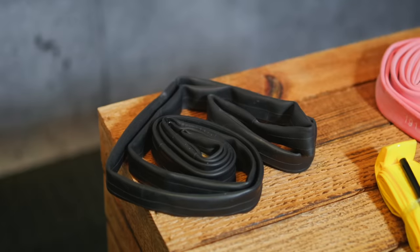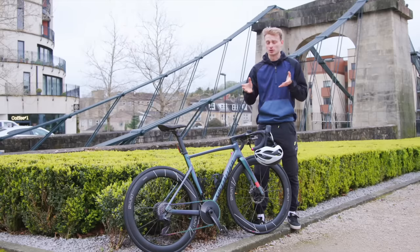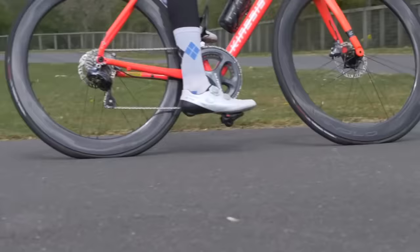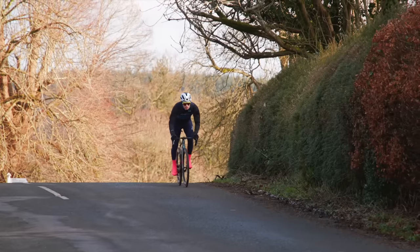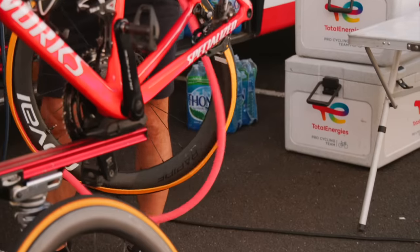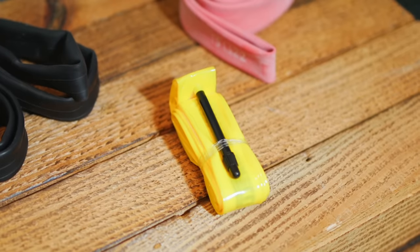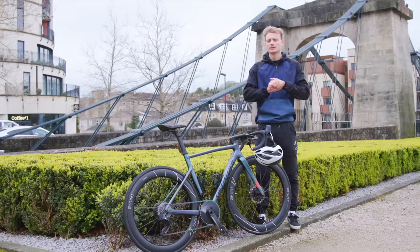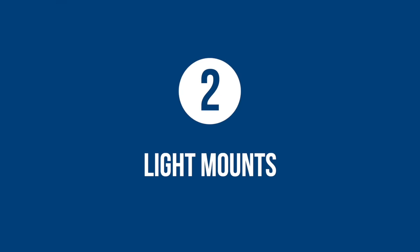You know the heavy cheap ones that come with just about every bike on the market. I'm not here to start an argument about whether you should go tubeless, but literally all the alternatives are better than butyl. On this bike I've set it up tubeless, but I'm also a fan of latex inner tubes, which are lighter and comfier than butyl but need pumping up more regularly. Then there's TPU tubes, which are lighter, roll faster, and feel better than butyl — so any one of these three options is a great value upgrade.